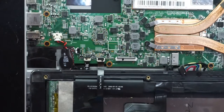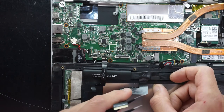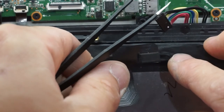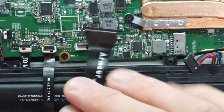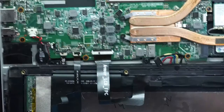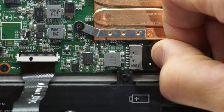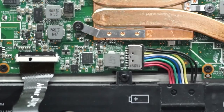Also, this cable is replaceable as there is a connector over here, and this one, if you have display issues, does pop off. To reattach that you'd push down here. Feed the display cable into its connector and pull the latch down — that's now reconnected. Once we're at that state we can fold the screen up. Remember to reconnect your battery: wiggle it slightly, push it that way, pull it towards the other end — that's reconnected.